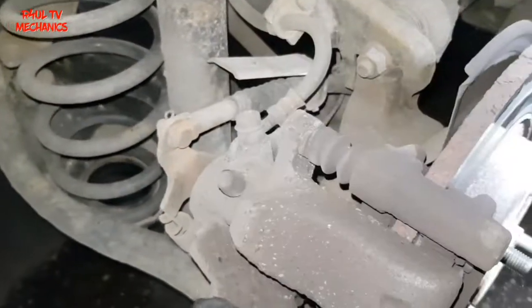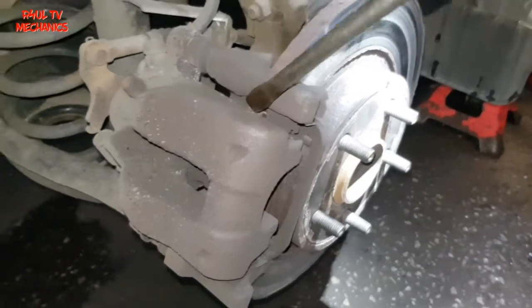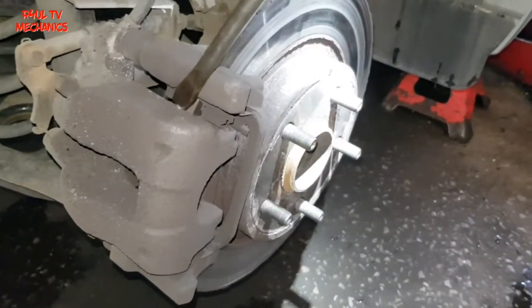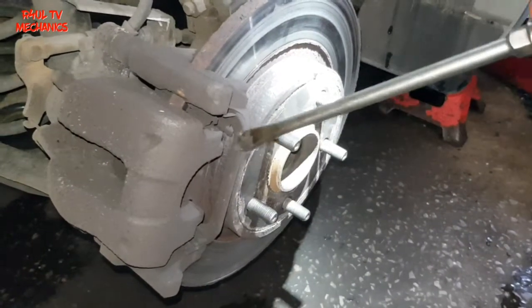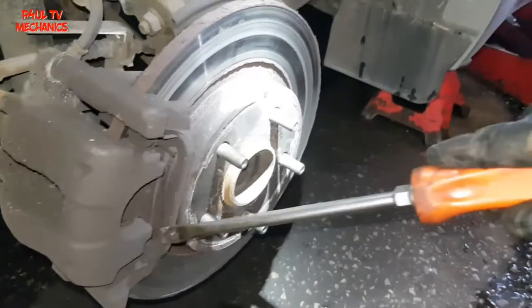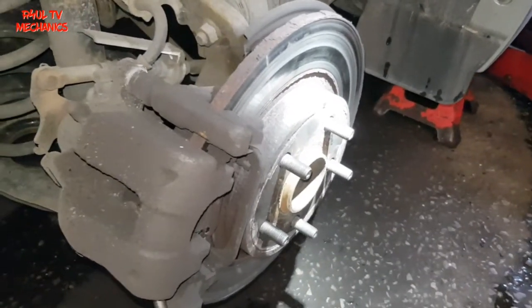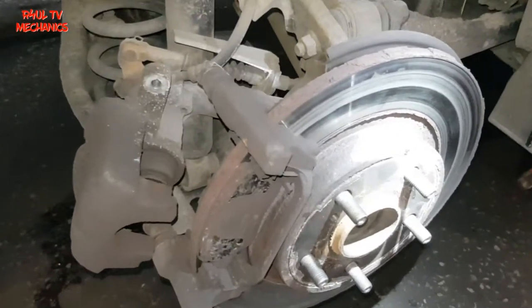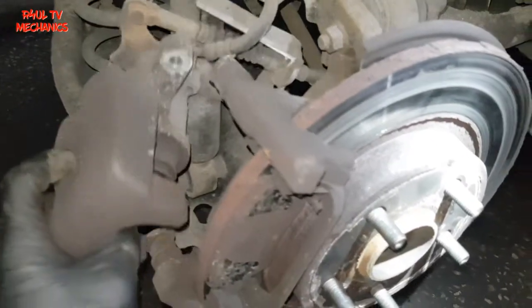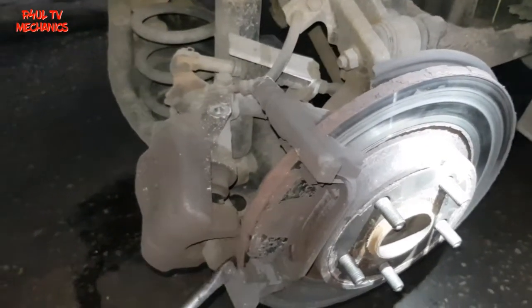I've took them two 13 millis off. All we do now — dead simple, like any other brake caliper — just fire that off, not rocket science. Just get a screwdriver and pry it off. There we go, once it goes it will go. Get both hands on it for a bit more control. That's out of the way. Now I'm going to take the brake pads off — all we do is flick the brake pads off.